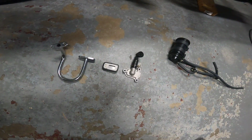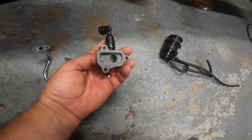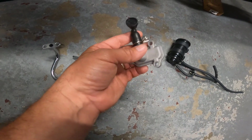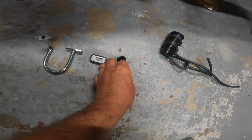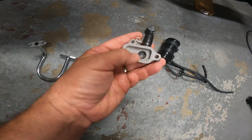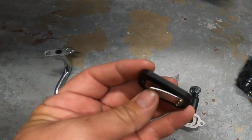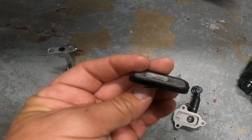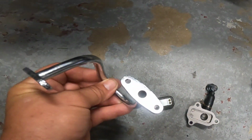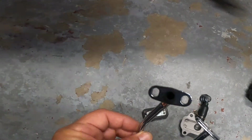PAIR. I guess the question would be, is it needed, and will it harm your motorcycle if you take it off? Well, it's completely a California thing, and they're totally faking the sniffer test, the emissions requirement in California, with this device. What it's doing is pulling air in here. It's going into here where there's a reed valve, a one-way valve. On the exhaust stroke, it's letting air in through this valve, and it's pushing air through this pipe into the exhaust manifold on the head.